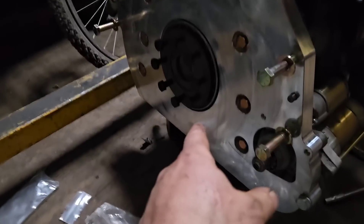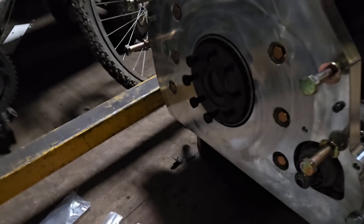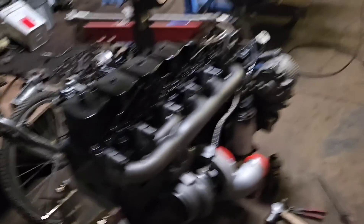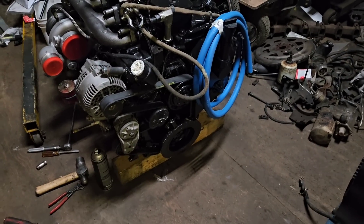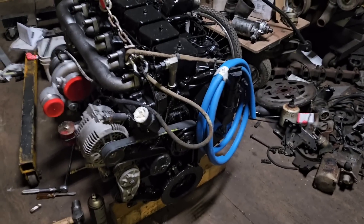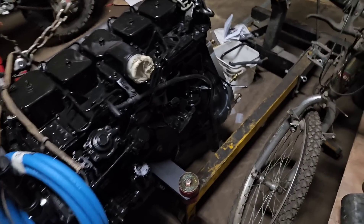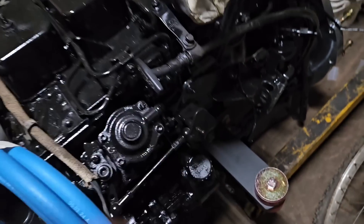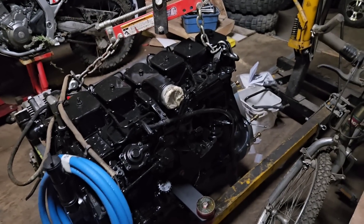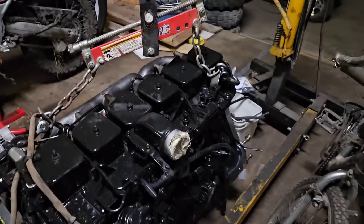I feel it's important to do the rear seal while you've got it apart. This is a brand new rear seal in this one. I have a front seal too — I haven't changed it yet; it's not leaking so I'm probably not going to. The front seal is relatively easy to do in the truck. The throttle connections are relatively easy on the VE pump — you just take the factory Ford throttle connection, hook it up right here and it pulls on the throttle. The fuel system is exactly the same — you can tie right into the factory lift pump. That's extremely easy stuff.